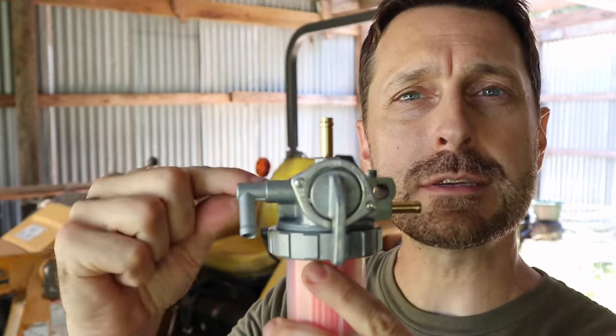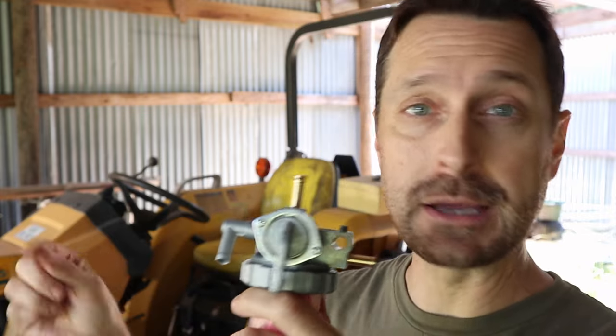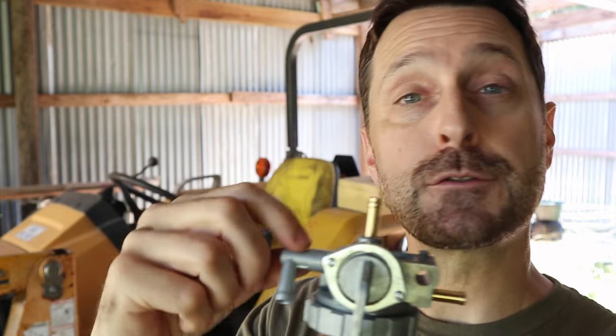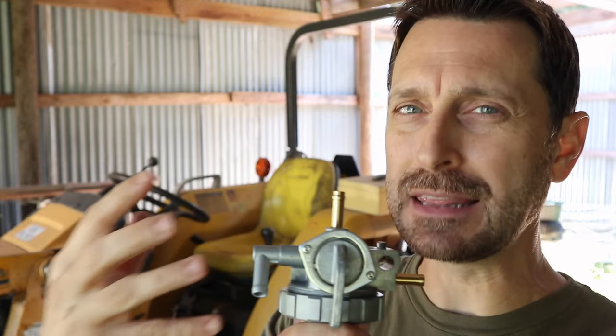On the old assembly, this is the piece that broke right here. I moved the tractor into the barn one day and heard a rush of liquid — that was all my diesel pouring out of my tank because this fitting right here on the inlet side of the fuel filter popped out. I tried to replace an o-ring or whatever was in there, but it's not that.